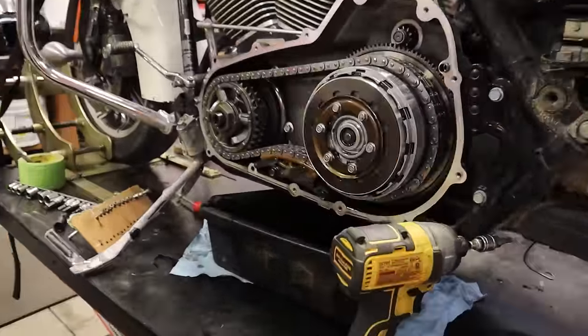Got that? So we'll set our torque wrench. You're going to start here with this one. I got the green light. Okay, double check your lines — they look like they're at 90 degrees. Yeah. So the head's torqued down. Cool. That's very specific torquing.